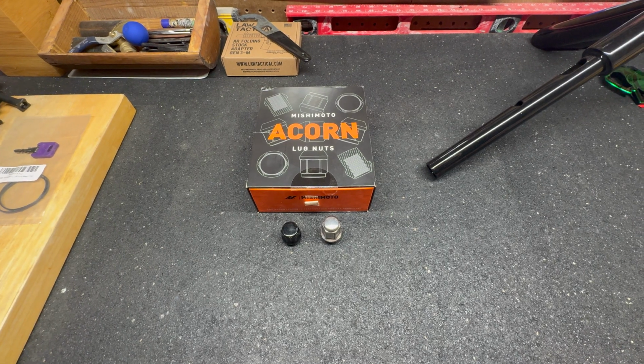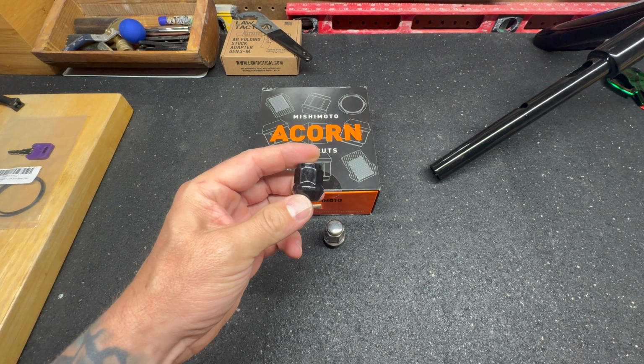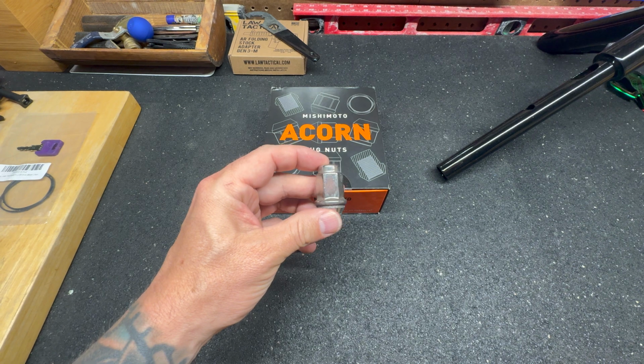The next thing we need to talk about is lug nuts, and if you've been watching my channel for a while, you know that I like to point out my own mistakes in hopes that you can avoid them. The mistake I made on this one was purchasing these Mishimoto Acorn lug nuts because the depth of the lug nut was not deep enough for the wheel stud. This is the stock lug nut for my Corvette, and you can tell that it's much deeper.